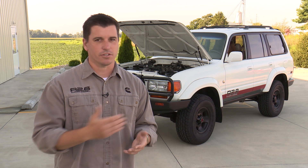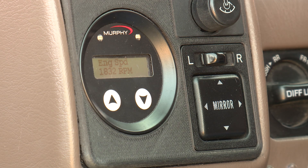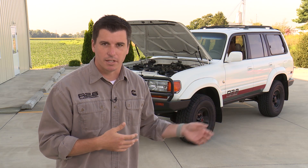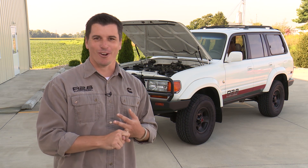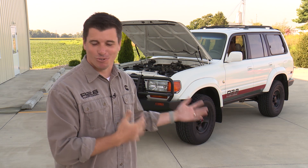That is a safety feature — your engine is revving up to 3,000 RPM during this test, so you don't want your truck in the garage or aimed anywhere, as you run a risk of it popping into gear. Use common sense and safety practices. Also be courteous — don't do this at midnight if you live in a neighborhood, because it's going to get loud at 3,000 RPM.